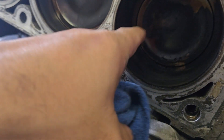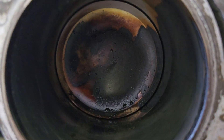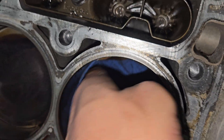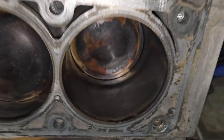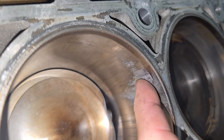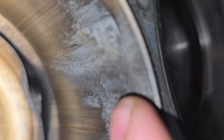I was able to spin it over a little bit - there's just gobs of oil in here. I wonder if something else is hurt down the pipe because this is just full of oil - a lot of oil. Getting the flashlight in there - yeah, I can feel it. It's really, really charred up right there - a good size indentation.